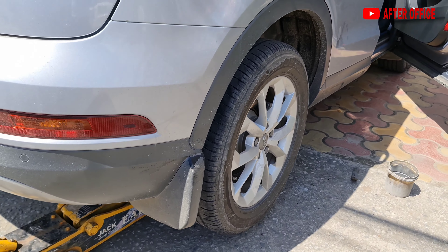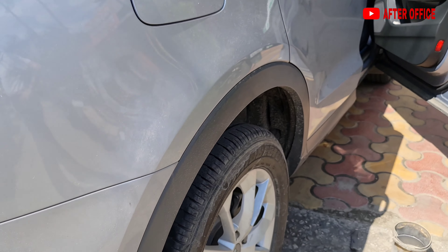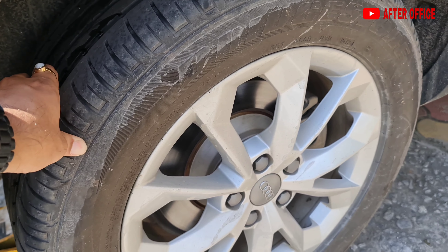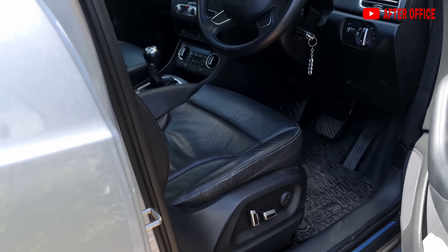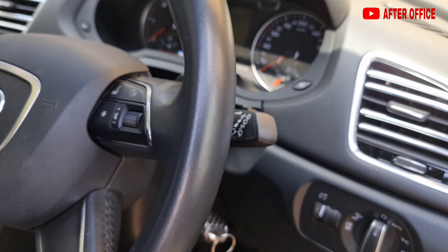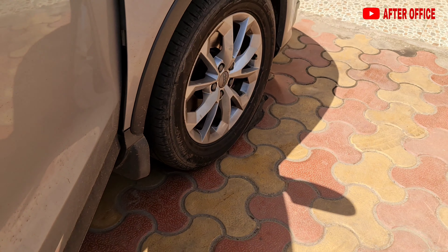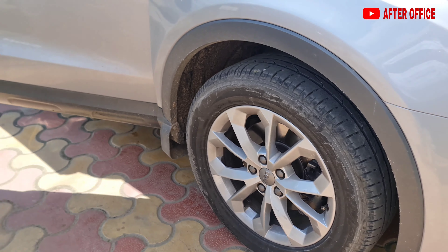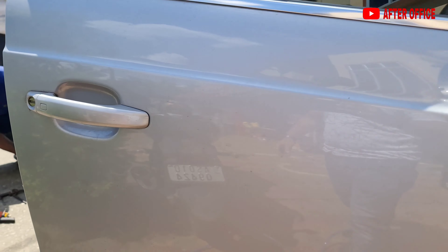We have raised the car. This is an Audi Quattro four-wheel drive, so the tire is being raised and we can easily repair the puncture without removing the wheel. As this is an automatic car, I have started the car and put the gear lever from parking to neutral, so the rear wheel can be easily moved. The car is in accessories mode — half start. On the front wheel I have put some packing so that the car does not move forward.